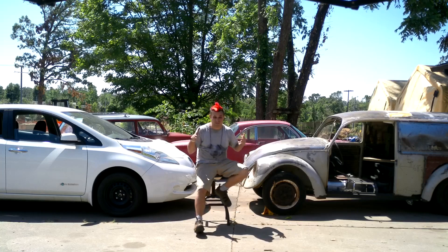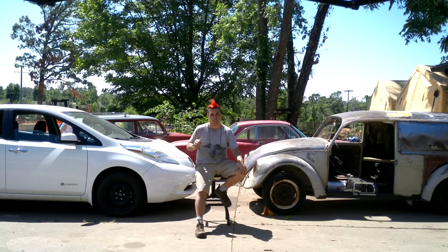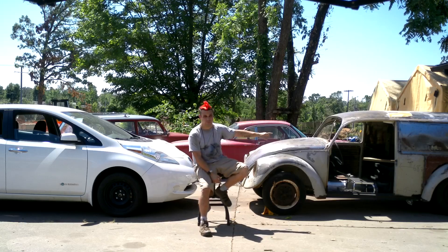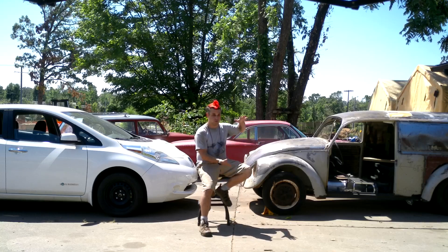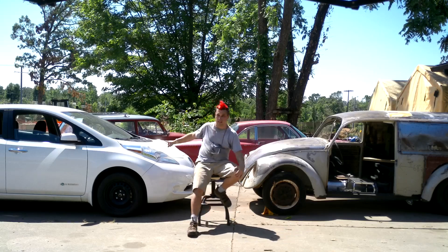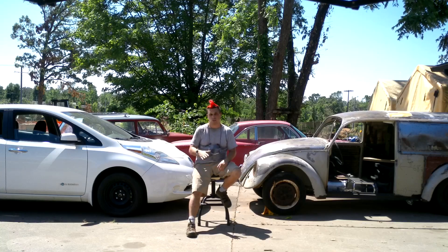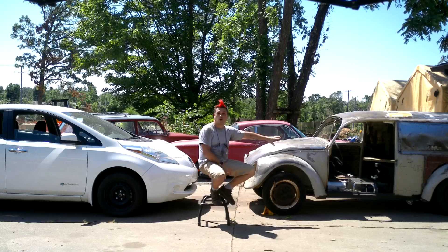This guy has enough room in the back — I've done a ton of measuring today. The traction battery is 61 by 46 inches, and I have 62 by 48 in the bed of this panel bug. The motor is going to have to fit underneath that, so I'm definitely going to be squished for height in the back. But the top sections — about a foot and four inches of this drivetrain — are the controller and charge controller, all that stuff. So I can chop it down. It gets really small really fast, which means I can put the charging components in the front.